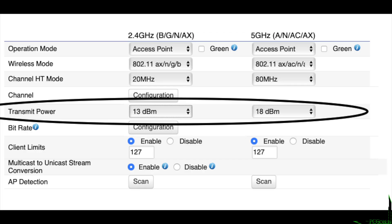I use pretty much all the default settings. The preferred setting is to give about a 5 dB difference in power between the 5 GHz and the 2.4 GHz — I just leave it as auto and it performs fantastic, giving me amazing distance out of the 5 GHz channel. If you're curious about performance, check out my speed test comparing the iPhone XS Max versus the Samsung S10 — you'll be quite surprised at just how far I can get from my house using just the 5 GHz channel. That's unheard of with my older Ubiquiti 802.11ac stuff.